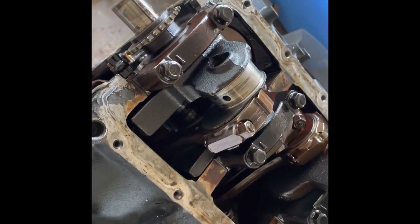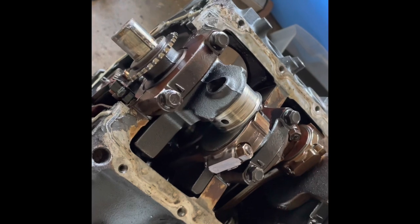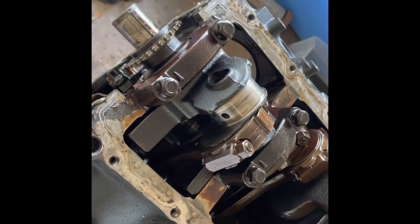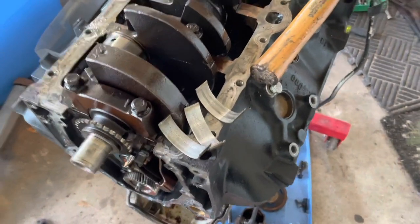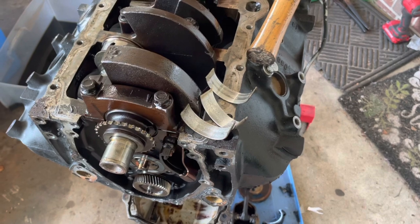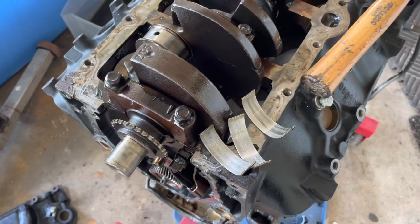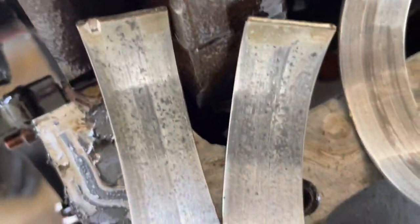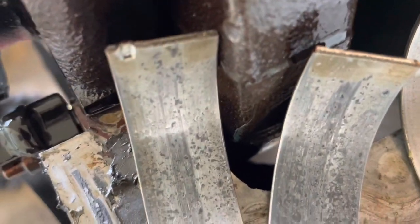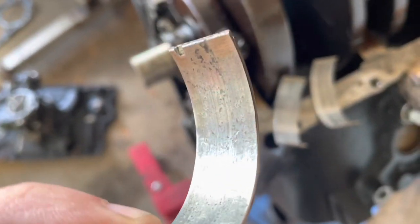This one may not have been so bad that it would have done that - it's probably still running at the time but making a good knocking noise. That's what the common rod knock looks like and what the results of rod knock look like. If you keep running your engine with that knock, this is what happens and it'll get worse until it finally breaks and slings through the side of your oil pan. Going through this engine pulling out rods and pistons - as I said, the number one rod bearing was gone, and I was wondering why just one. But that's not the case - here's number six. You can see metal is starting to peel off that bearing.